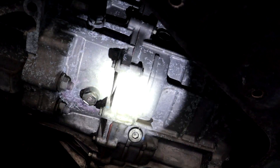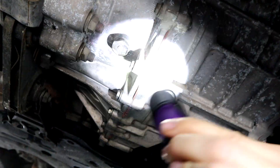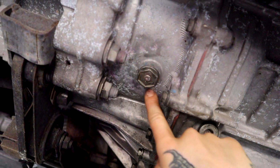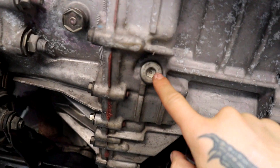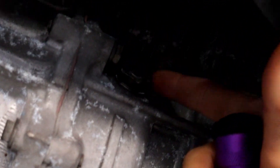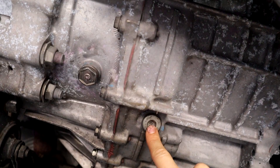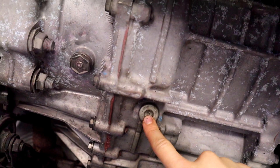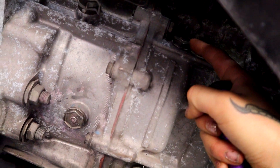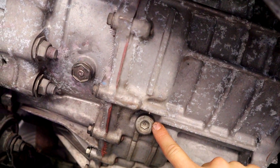There are quite a few different plugs — we actually have three. This one right here is to drain the coolant; you can see it looks like the coolant has been drained before, there's a little bit of pink residue around it. This one is to drain the hybrid transaxle. And this one up here is our fill plug. I'm going to start by loosening the fill plug first, because it would be awful if we drained all the fluid out and then this was seized or crusted and I wasn't able to get it undone.